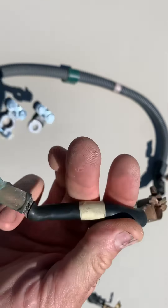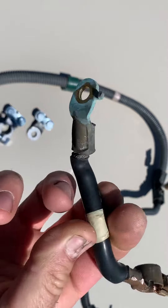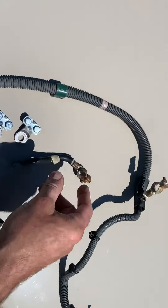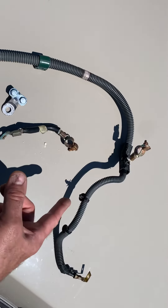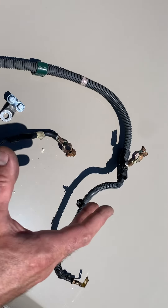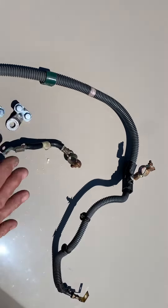But if the cable is corroded inside where it's hidden, you cut that back a little bit and you'll see this cable end-to-end is shot. That's when you want to replace the whole cable. Aftermarket — this is from a Honda, from an Accord — they do make complete cable assemblies.